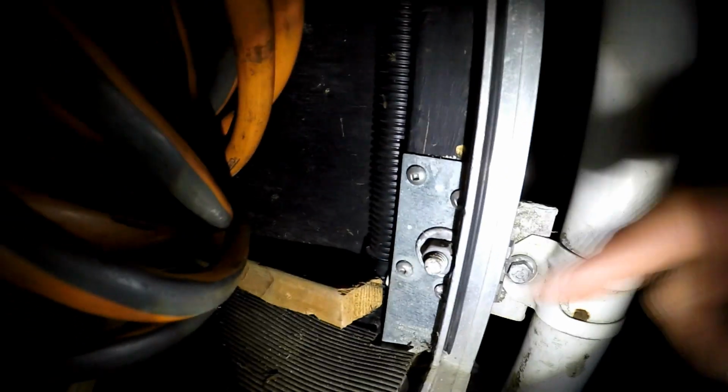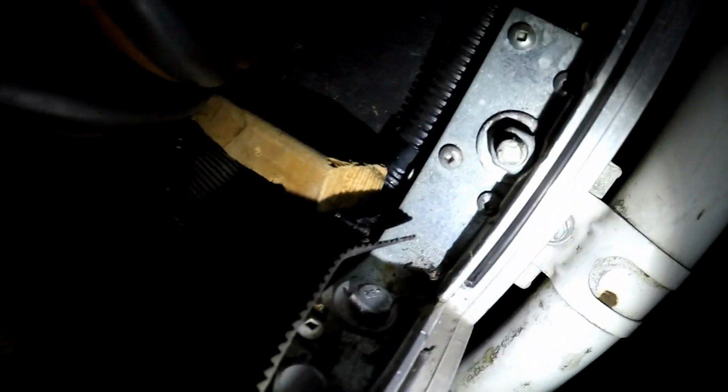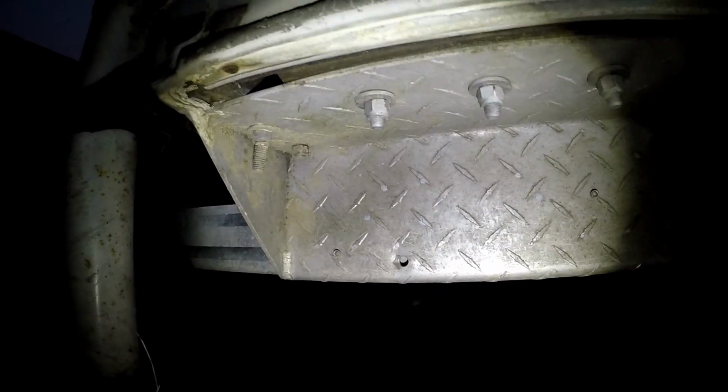It's about an 1/8 inch thick. It's a fairly good gauge, and I've got two 3/8 inch bolts here, and there's also 1 inch or 1.5 inch stainless steel screws going into it. This is a 3/8 inch bolt that goes through the 2x2 frame, and there is the head of the bolt there, and so that is what connects the right side mount bracket solidly to the framing of the camper, and it has the same stainless bolts all up and down it, so it's very solidly mounted. You can see the mount bolts underneath here.